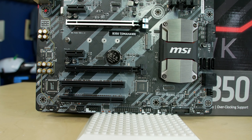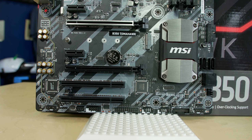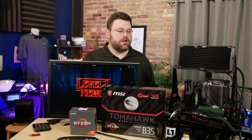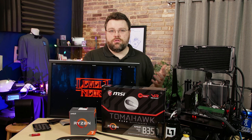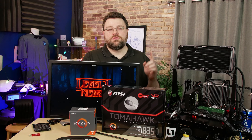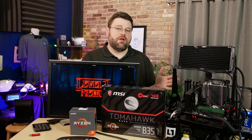Let's talk about the expansion slots. We've got one x16 slot directly wired into the CPU — that is x16 electrical, always x16 electrical regardless of what peripheral you're running. Then we have two PCI Express x1 slots connected to the B350 chipset, and another x4 PCI Express slot just below the graphics card. The manual says you can run Crossfire with this motherboard. I was able to install a Radeon RX 480 and a Radeon RX 460, boot to Windows, and use both graphics adapters. Crossfire is supported in GPU configurations. However, I was not able to boot Linux with SVM — AMD's virtualization technology — enabled with both graphics cards installed.